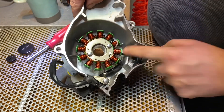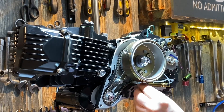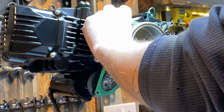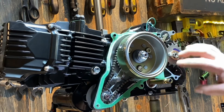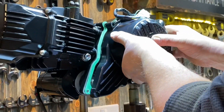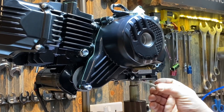Do a final press down so you know the cable's got a good run and is not in the way of the flywheel — the flywheel does sit further up than the cable. Cover on — dowels cleaned up, in they go one at a time. Lay the gasket on, make sure it's intact with nothing stuck to it, and check that the neutral grommet is located nicely. Check the flywheel has nothing stuck in there — no shards of steel. Drop the cover straight on. You've got three of the same length bolts and one short one — short one in the front, the other three in and around.